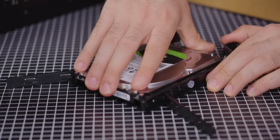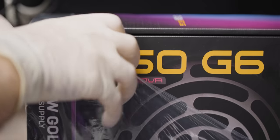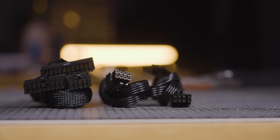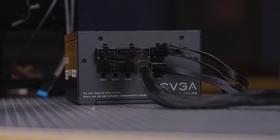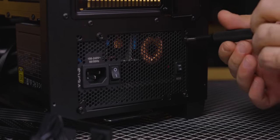Take your hard drive and place it in one of the 3.5-inch bays at the bottom of the case. Our 650-watt modular power supply comes from EVGA — the G6 80 Plus Gold. You can save some money by going semi or non-modular, but you could end up with some extra clutter. Open the box and take out your PSU and its cables. Separate the ATX 24-pin, EPS CPU 8-pin, PCIe 8-pin, and SATA power connectors, and plug these into the back of your power supply. Don't force them — these can only go in one way, so if there's too much resistance, you might have it backwards. With your cables attached, slide the power supply in sideways, pull your cables out of the way, and screw it in with the four power supply screws.